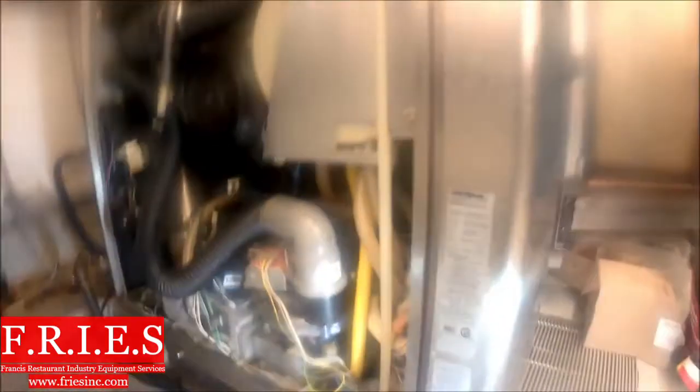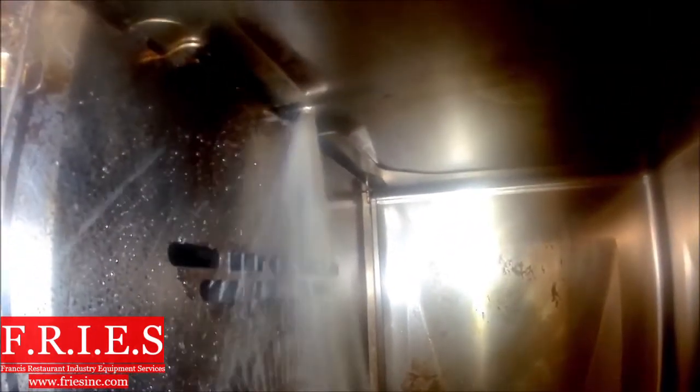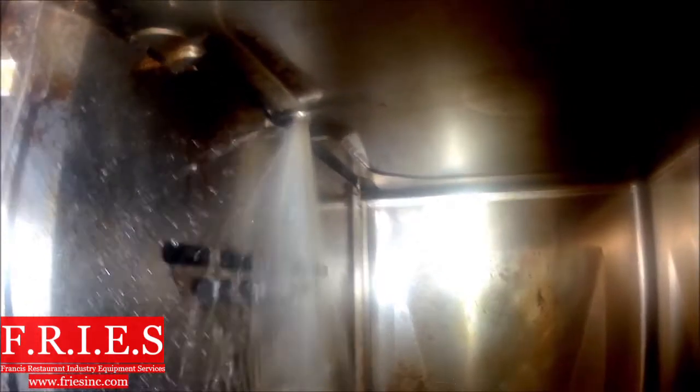Same steps as earlier — let's dump the water in, make sure she's not pumping out of the drain here. That's good. That drain valve's holding. Let's go ahead and test our pump. And you can see we have full flow here — let me shine a light on this so we can see a little better. We have full flow, we didn't even have a drop earlier. So that pump was cooked.